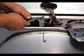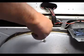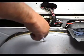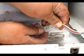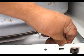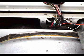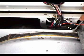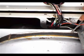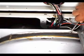Remove the coat hanger wire and tighten the baffle screw. Connect the door switch to the wire harness. Check the rear drum seal. If it's not in place, stick a flat screwdriver between the seal and the back panel. Turn the drum clockwise a couple of times until you have pulled the seal out and the seal is sealing properly.